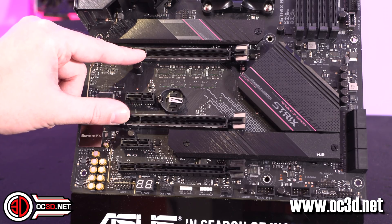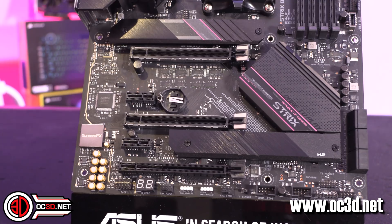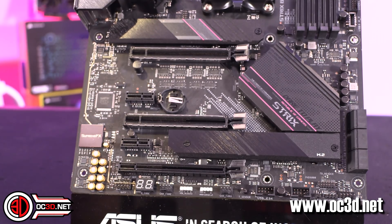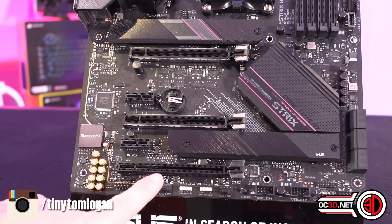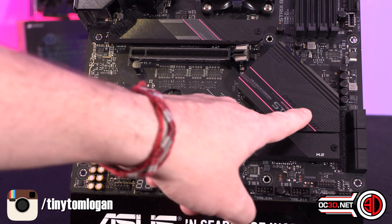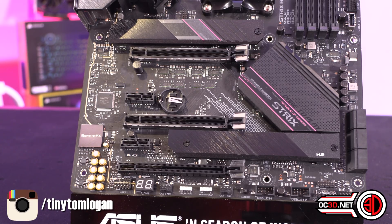There are two PCI Express 16 slots. The first one here is actually wired as eight, which is a bit strange considering the add-in card. So if you were to use that card in that slot it would only actually get half the bandwidth. And if you had a graphics card in there anyway it would only have half the bandwidth — so that's a strange one. The bottom slot is wired for four times and goes into the chipset, as does the one beside it. This one is PCI Express 3, while the other two share PCI Express 4 lanes going into the CPU itself. So that add-in card is a bit of a weird one — I think it's more of an X570 sort of thing.